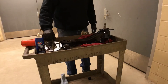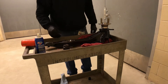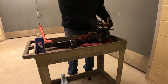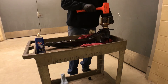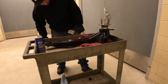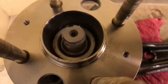To install the wheel bearing, make sure it's lined up and sitting straight. I use a 35mm socket — give it a few good whacks to seat it in. As you can see it's seated in only about two or three hits.